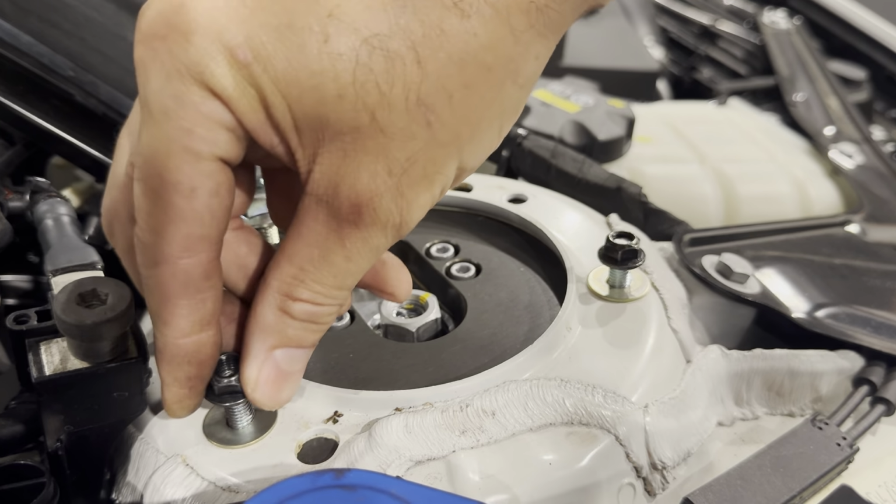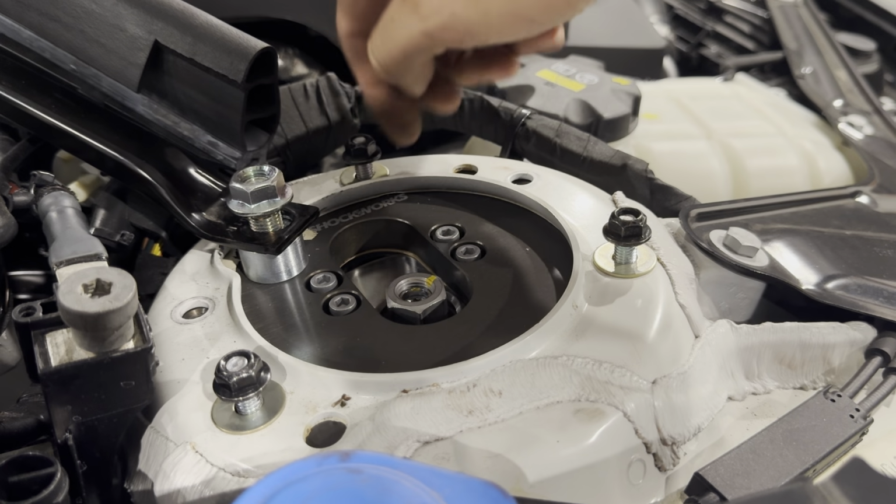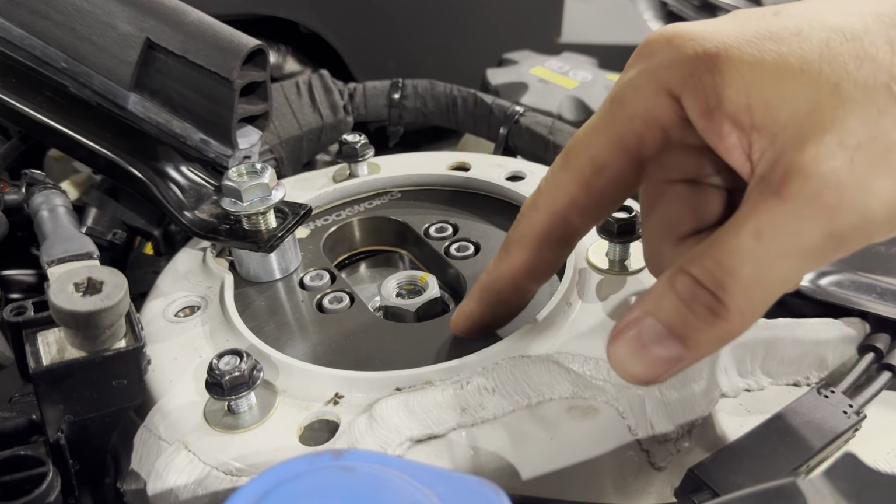So we are now in position. You see how much room we have. Camber adjustment here, that's awesome, so we can really crank it over. It's off-centered as it is, and you see that there. The hole is off-center, not in the middle, and that's even more so, so we can really get some more camber out of this. We weren't needing too much more, but another half degree or maybe even a full degree.